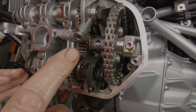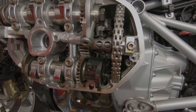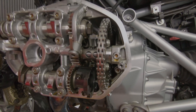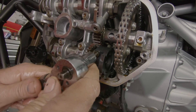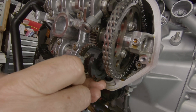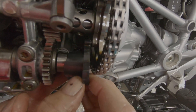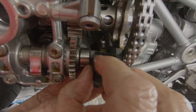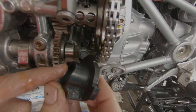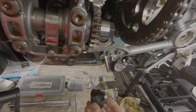This timing reluctor is correctly timed to the pickup, but the camshaft is not timed. In order to change the camshafts, we have to take this little reluctor off to access the bolt underneath. The bolt for the intake is available to be loosened, but not the one underneath here. We'll loosen this four millimeter allen and remove it. There's a cutout in the reluctor — you work it around until you get the space right and it barely slides out through the gap.